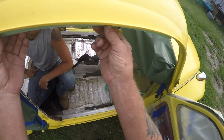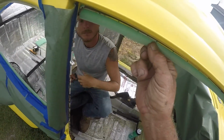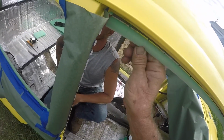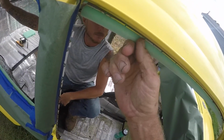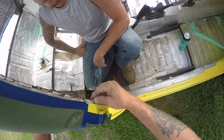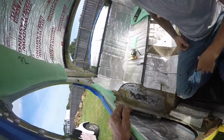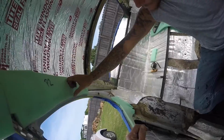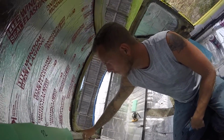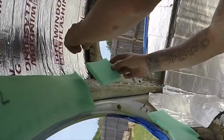As you see, he came across the pinchers, the grabbers here a little further, because he's going to trim it off to like 1/8 of an inch, just so that when I push the headliner up in there, it lays over the teeth so you don't see the impressions of each of these gaps and your headliner look like crap. He's going to do the same thing over here and then let it hang over and then trim a little bit after the fact, and you see where he stopped before the lip here. We're going to carry on and get this on here, and you'll get an example of what it looks like. Like this, it's about getting ready to sticking. Yeah, see, it's starting to pull it off.